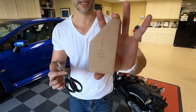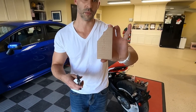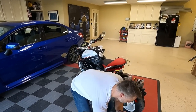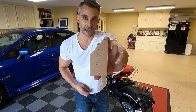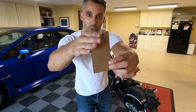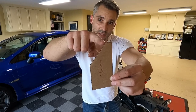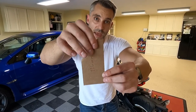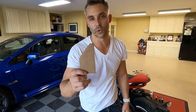What we did was take a piece of cardboard and a pair of scissors and measured out 116 millimeters onto it. We started with a rectangle, then cut the corner off so it's kind of an angled piece that gives a precision measurement of 116 millimeters from top edge to bottom. The reason for the angle is that this contour aligns with the contour of the swingarm — the swingarm kind of radiuses down at the bottom. You can hold this edge right against that leading indicator mark on the swingarm and the other edge against the chain, giving you an easy template to hold instead of fiddling with a tape measure.